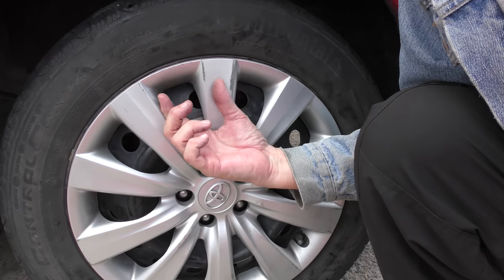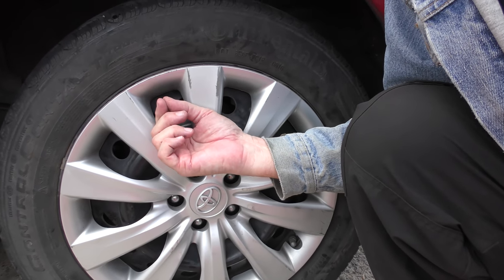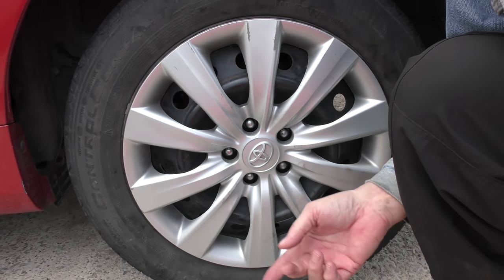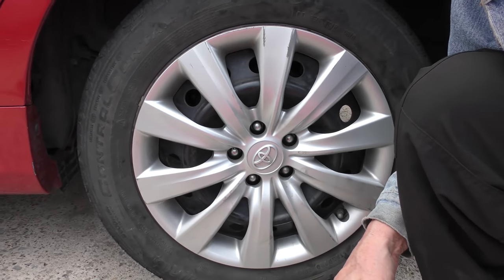What happens is, if the brakes aren't adjusted tight enough, they're slack — so it's got to go this far before it grabs. We've adjusted them. As they age, they don't adjust like they should. Years ago when I was a young mechanic, most cars had mechanical brakes that you had to get a wrench on the outside and adjust every so many thousands of miles to compensate for wear. These have automatic adjusters, but as they wear, they do wear up. Now we got a non-sinking brake pedal.